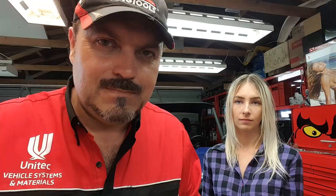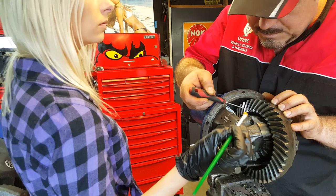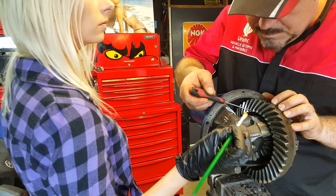Okay, the diff's in the vice. We're going to paint up some of the teeth on the crown wheel, then I'll show you how to take a reading and talk to you about what the tooth contact pattern means as regards adjustment. So Sam, choose probably five or six teeth, and paint this side of the tooth and this side — both sides — times six if you can. You only need a small amount of paint.